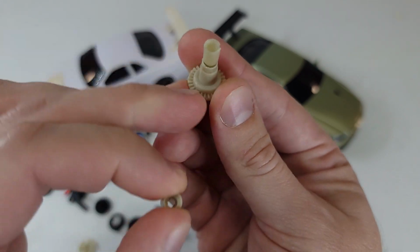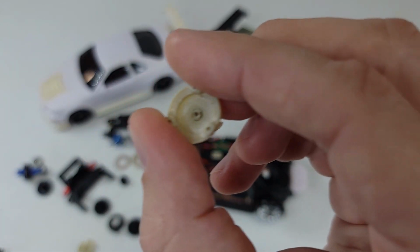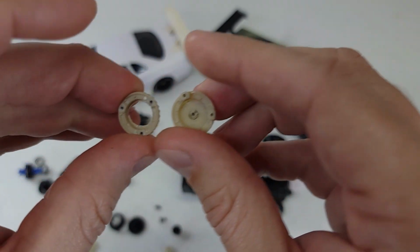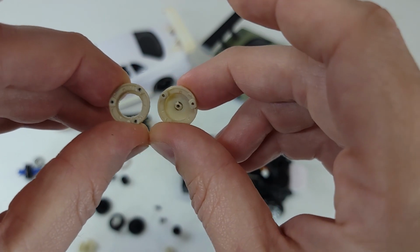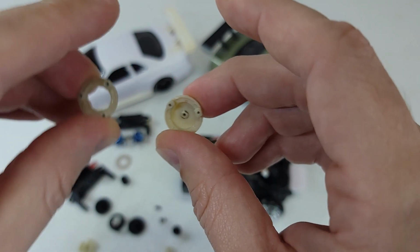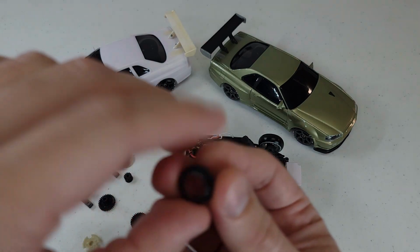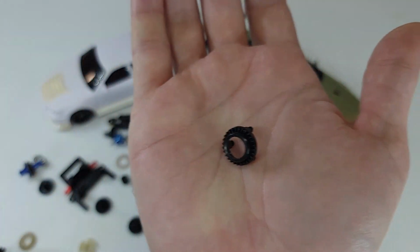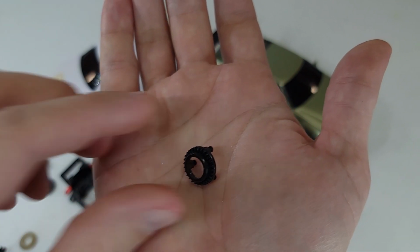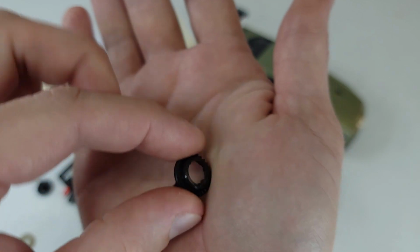So you just have to chop that off, and then cut a big enough hole where you cut this off to be able to slide over the differential, the rear rigid axle, I guess you could say. So this needs to fit over that, because you can see how big the hole is on the original. And I wanted to use all these instead of messing with the original. So if I ever want to go back to stock the way it was, I can always go back.